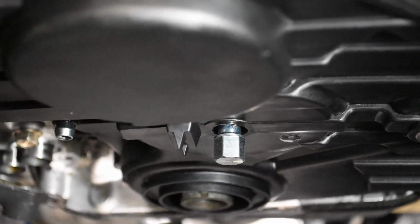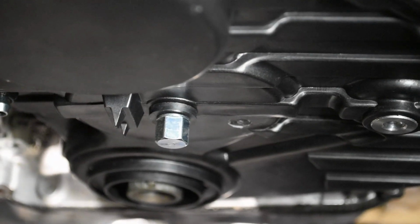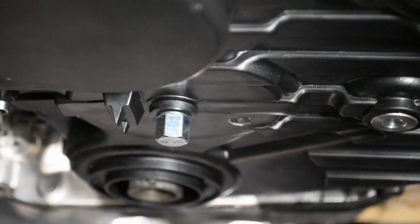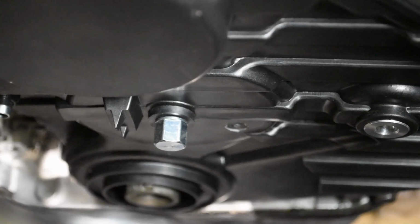is go down here and put the grommet on the end of the tensioner bolt. This grommet, I feel, is another one of those oft overlooked items that does help keep dirt, debris, and excessive moisture away from the timing belt itself. So I'm going to go ahead and work on the rear upper cover next, and I'll show you how that goes.